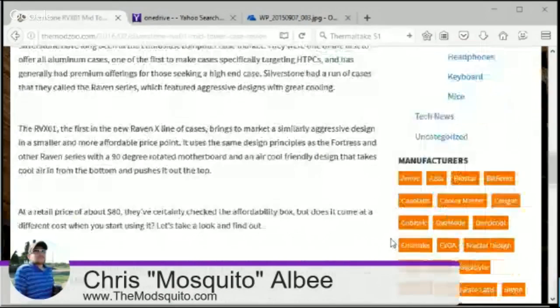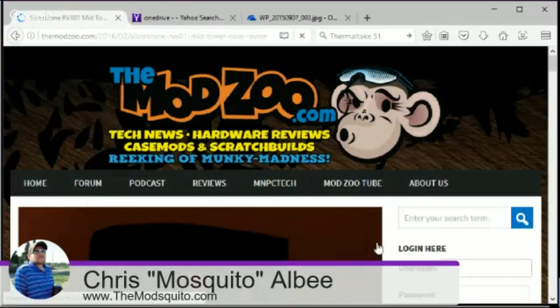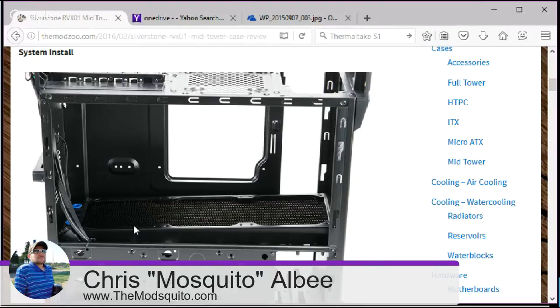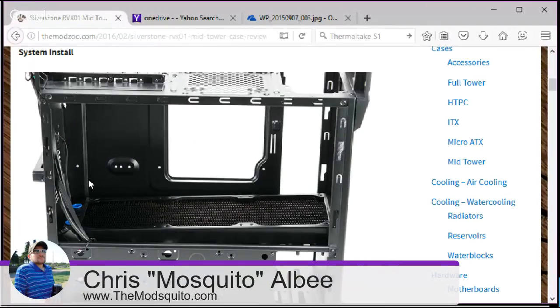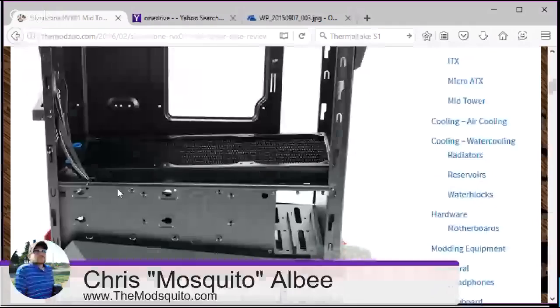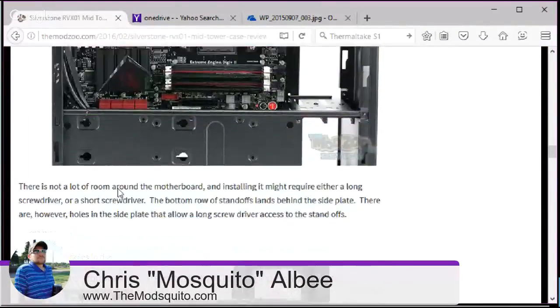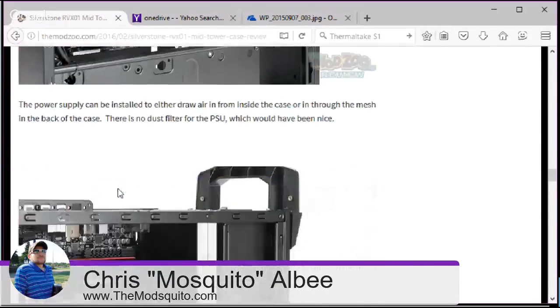Well, what I want to do is, here we go. I showed that you can fit a 360 in there if you hack some stuff up, namely the drive cage. So I want to do that and throw a micro ATX board in there and then throw the reservoir down here on the end. Not too crazy heavy modding, but I think it'd be fun. Yeah, I think it'd probably be a first for that too. Could be. It's an R8 case.